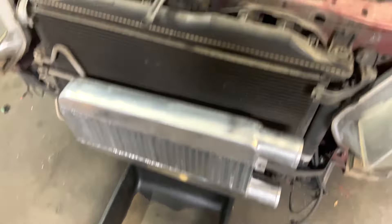I'm going to show you what we've got to put on here for the turbos to clear, and so you can get the wastegates to work. We're going to start by taking off the intake, undoing some of these cooling lines, getting rid of some of the stuff on the valve cover that's cluttering it up, and getting rid of this little plastic piece right here that's really unnecessary.